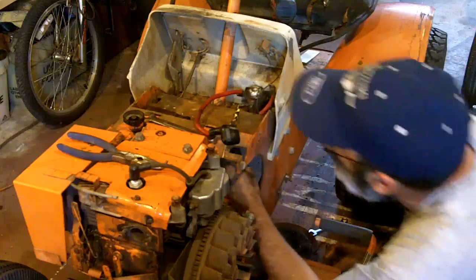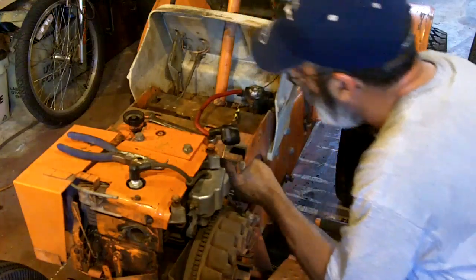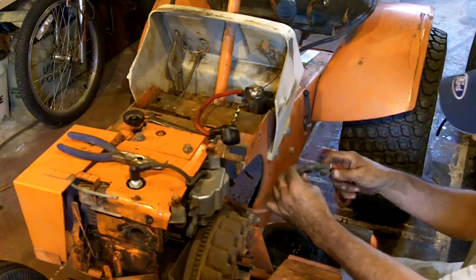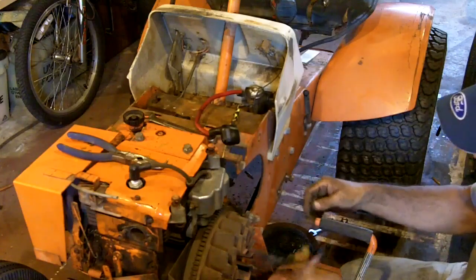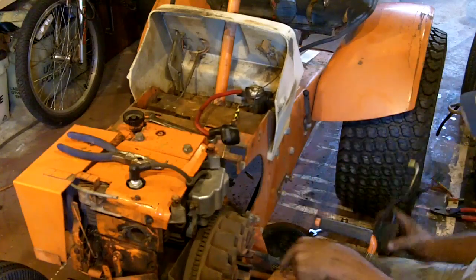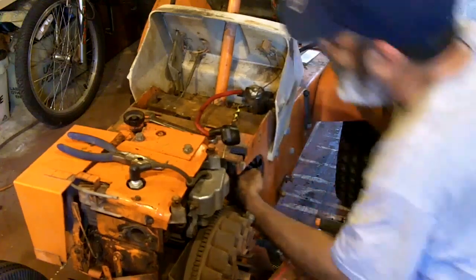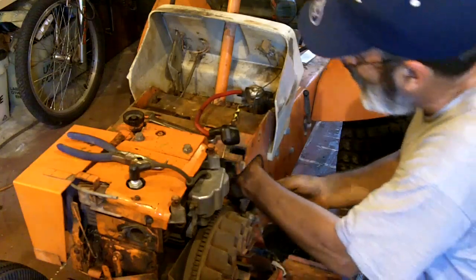Hold on just a sec. Holy moly. Look at this thing. Yeah, I'm going to be changing that. It's 2 cables spliced together. That won't be staying. Oh, the things that people do. That's a fire waiting to happen. If you cranked on the engine for too long, guarantee that connection is not good enough inside of there, and it'll melt and then catch on fire.